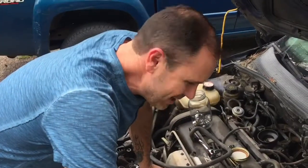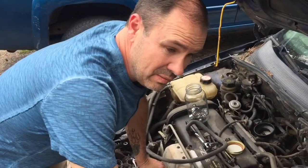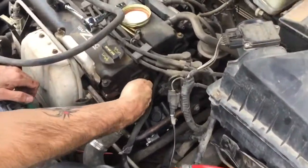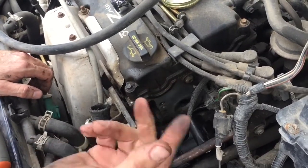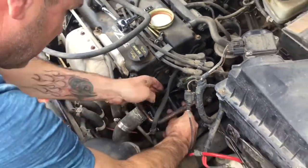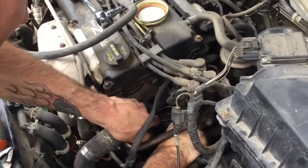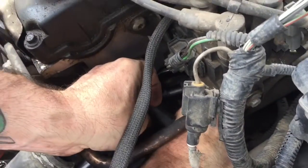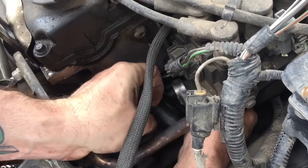We're back. Okay, I know this is an extremely long video and it's not the best one, but it's gonna do the trick. Now just wipe this off before you put everything back on. There's some grease on here, and just wipe that off. And then what we wanna do is try to hook up this back hose clamp first, while we have room to work. So we'll put that on first, right there.